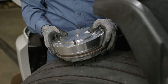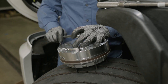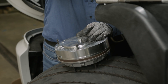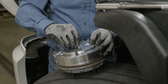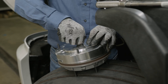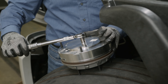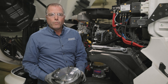Now we're going to replace the face seal. We'll remove the old face seal and replace it with the new face seal that came in our air cartridge face seal kit. Make sure to grab your inch-pound torque wrench — this will be torqued to 62 inch pounds. Once the new face seal is installed, the clutch pack is ready to go back on the vehicle.